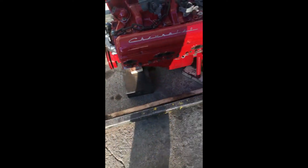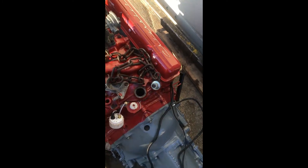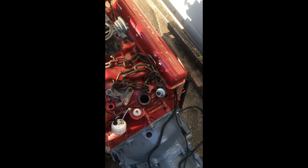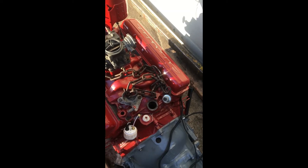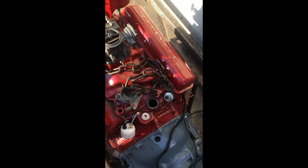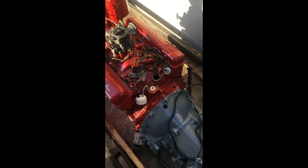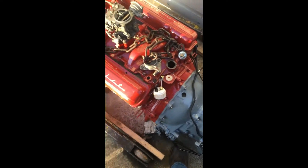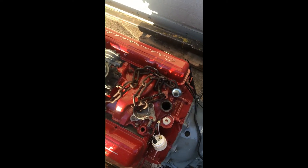All-American build. A couple people asked me what happened to Ethan's motor. Well, we ran into a complication on the shaft that goes down to the oil pump that the distributor runs on. We found out that there are two different sleeves that fit over the shaft — one for new oil pumps and one for older oil pumps. What happened is we got the long sleeve on this one, which does not let the distributor drop all the way down inside. We need the short sleeve.